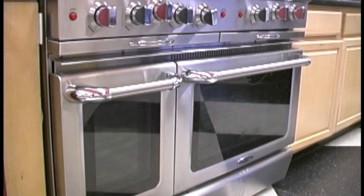The reasons you may want to do this are if you want to clean the oven — if you have a manual clean oven, taking the doors off gives you better access instead of having to lean over the door; you can actually climb right inside. The other reason might be if you take delivery of the range and want to drop some weight off it or make it safer for builders or contractors to bring it in. One thing any contractor or builder must not do is lift this range by the handle — if you do, you'll distort the door and bend the hinges. So, a simple way around this, I'll show you how to do it.